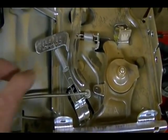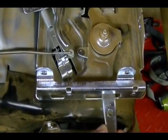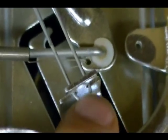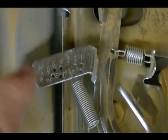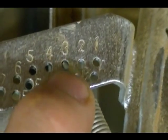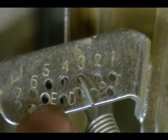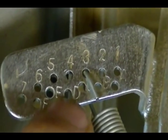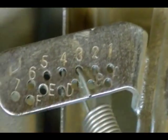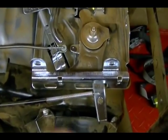The next connection point is for the spring which is adjustable, which is right here. It connects on one end to the arm which is controlled by the throttle cable — zoom in here so you can see it. The spring kind of looks like a paper clip. If you go to the other end, it connects to the governor arm. For this piece of equipment, Husqvarna chose to use the number three hole. Which hole you choose will change the top governing engine speed, and if you find this engine on another piece of equipment the manufacturer may choose to use another hole, but for this tiller they've chosen the number three hole.